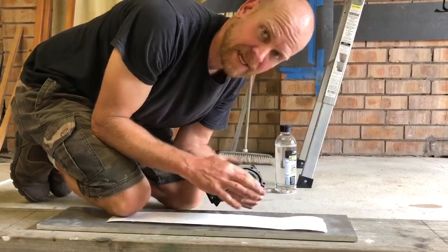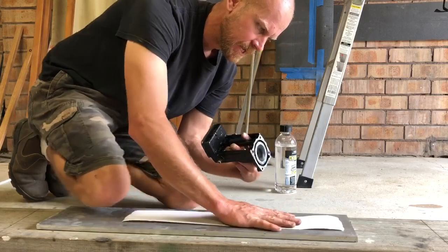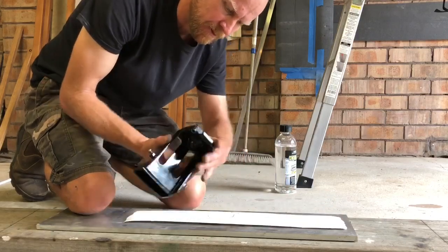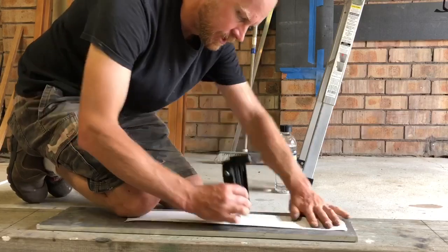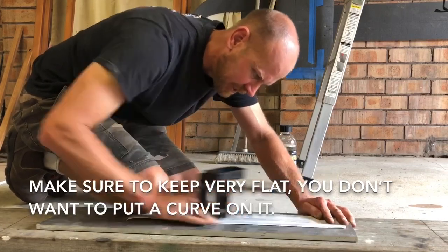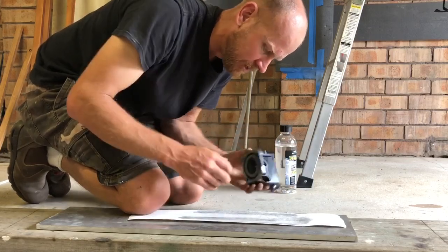Just going to sand the end of this flat — that's the head from the 3.3 horsepower. So I've got a thick piece of aluminium, it's probably half an inch thick or 13 mil or something like that, and a piece of sandpaper on there. I just really want to get that flat, so I just rub it on that flat surface. You can start to see it flattening out the high spots. I've just degreased the whole block and the head.